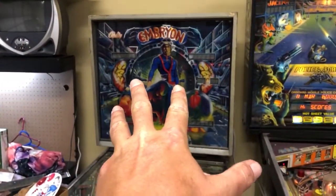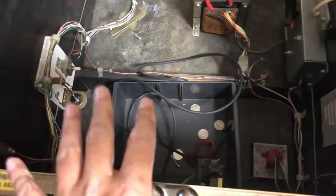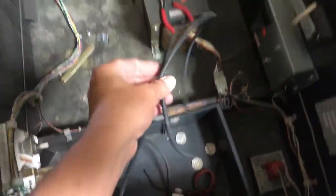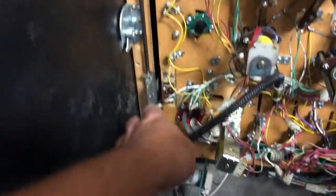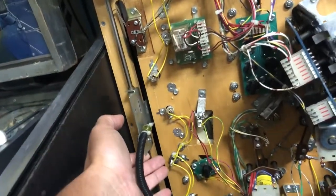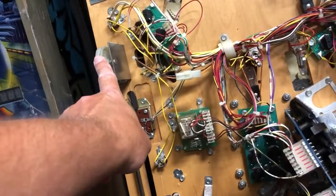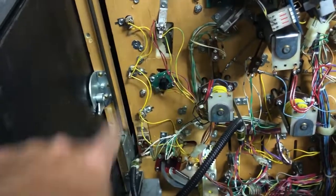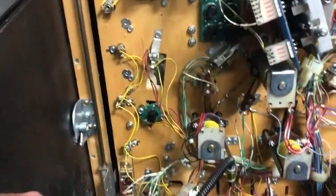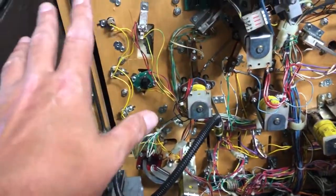The Embryon is a whole other story and we'll get to that later. Here are the insides of this machine — everything's pretty clean down in here. This giant rubber used to belong to the car. The car mech travels up and down this rod section, and there should be a giant belt on this pulley and also to this second pulley — that's what moves it back and forth into place. The switches are working. They were showing errors because the belt was broken and they couldn't be touched. We've ordered a new belt, and we've got a new rubber kit on the way.